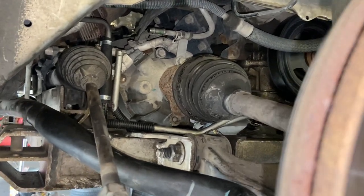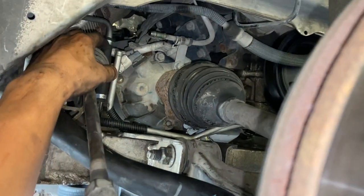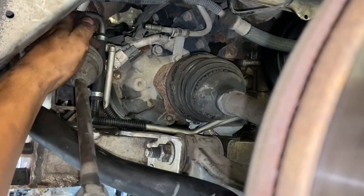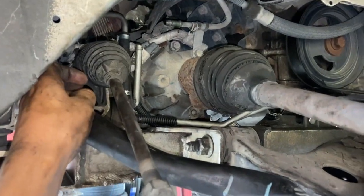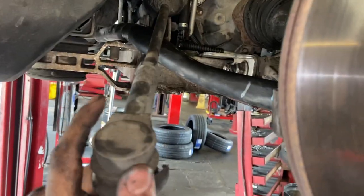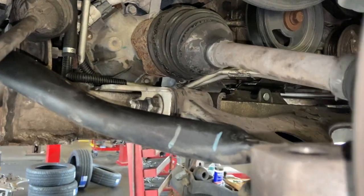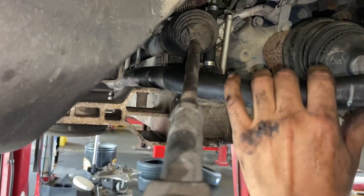The little connector that I have missing — I tried different ways to get it on and get it in here. Getting it off is easy, I just had to cut it. Putting it back on in one piece is pretty hard because there's only one flex point right here. What I had to do was remove the passenger tie rod from the knuckle and remove the sway bar.